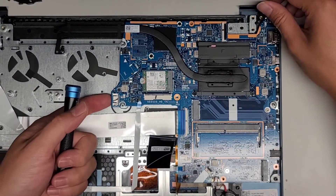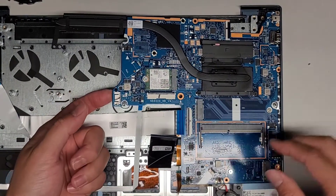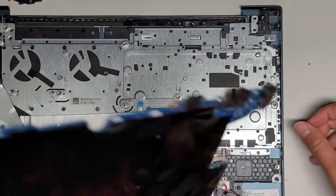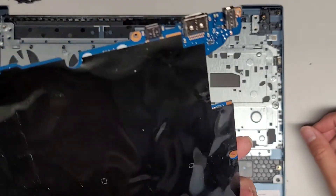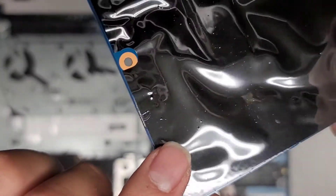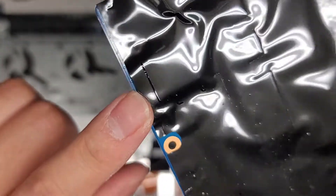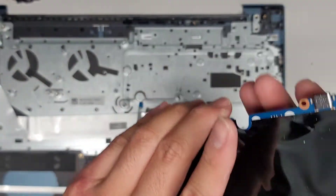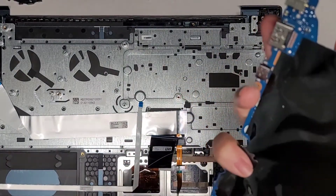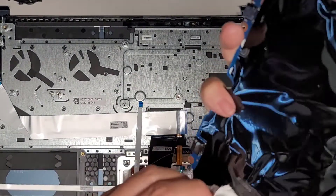It looks like it's lifting up, so we're going to carefully lift the motherboard up and out — at an angle like that. Then we can grab it here and slide it over. Looking at the back, I see a few splotches of that stuff but not really much — oh there's like a line of it dried right there. I don't think there's enough damage here to cause it to not turn on, other than that hard drive cable. Look at that purplish pink stuff. We're going to try and wipe this stuff off.